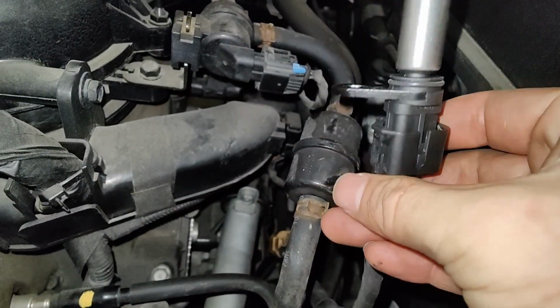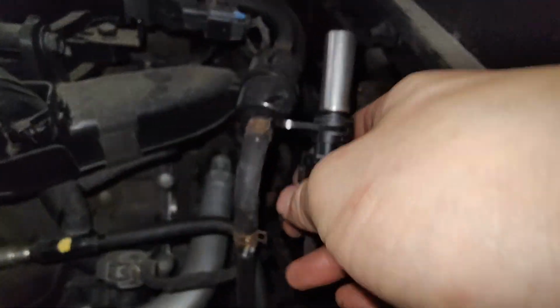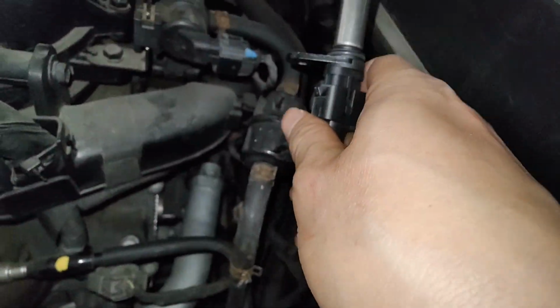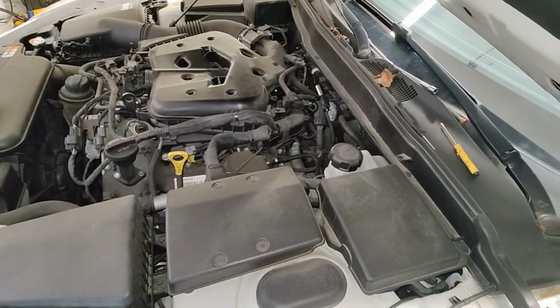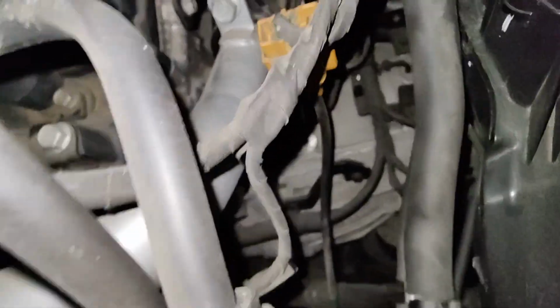So yeah, I connected it. It's all the way clipped in, and I'm going to stick it back down there. Then I'm going to start the car and make sure it actually starts. And yeah, that's about it. So let me just get that back in there, with a 10 mil bolt. All right, so I got that crank sensor in, and you can see it's bolted on.